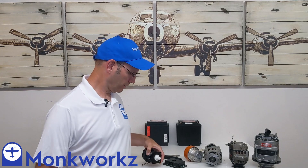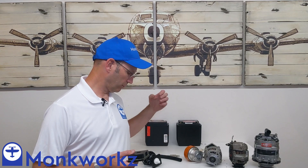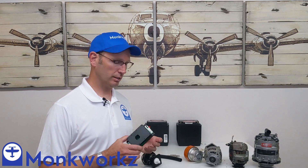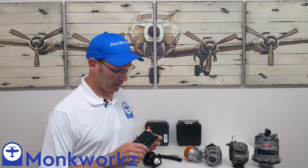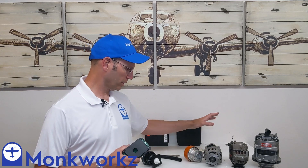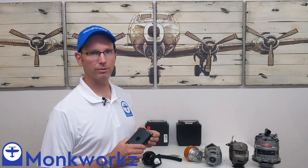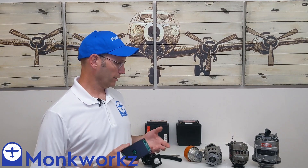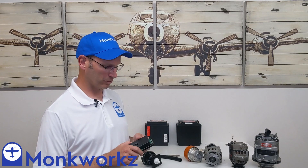Power density is here. The next part of the equation is trying to figure out how to manage the power coming out of here. You've got variable voltage, variable frequency AC coming out, and you need constant voltage DC coming out of the regulator. So the regulator handles all of that. To me, the fact that we're running around with systems that are 40, 50, 60 years old — when there's something better out there — is kind of like running around with flip phones when everyone else has iPhones. Experimental planes are generally the forefront of general aviation, and this is what we've come up with now. I think it's dramatically better than what's out there.